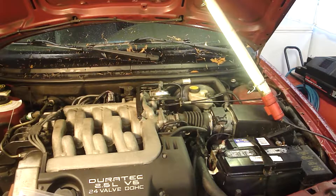There's a bleeder valve that requires bleeding as well, so I like to do that. The reason why I like to have clean fluid is that I keep my cars for 20 years. If you're going to keep your car for five or six years, you don't need to worry about it. But moisture can cause corrosion of the internal brake parts. Having moisture in your brake fluid lowers the boiling point. So if you're going down a mountain and your brakes are real hot, if you have 100% brake fluid, the boiling point is higher and your brake fluid won't boil. If you have a lot of moisture, it's going to be easier for the brake fluid to boil away - and when that happens, you have no brakes. So it could be dangerous.